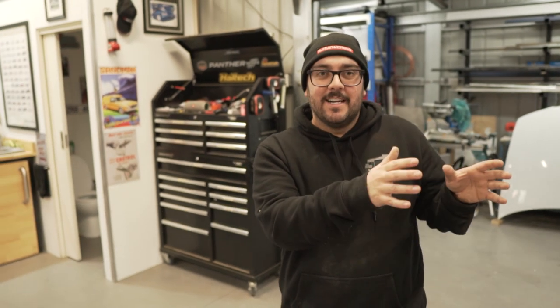All right, Nathan, what are we doing today? All right, we are getting into the LS1 today. We're gonna start stripping this engine and putting all the Crow Cams goodies and all that engine parts that we have. So we're gonna be pretty much pulling this engine down to just the block and leaving the crank and pistons in, because we've got head studs, head gaskets, and we've got seals and all that stuff to replace as well. So we're gonna be getting into the engine while Daniel is gonna be in the background cleaning the car because it is filthy in the engine bay, gonna neaten it up a bit, maybe cut out that AC.